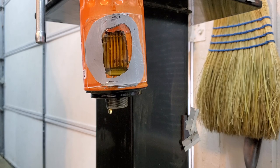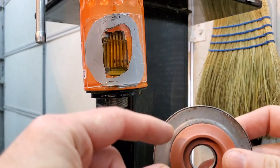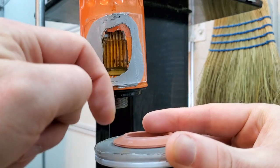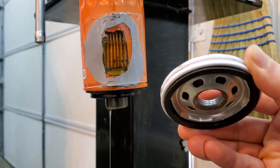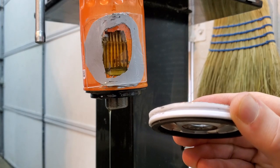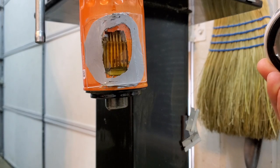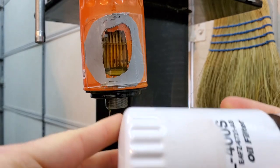You can see it's seeping through the filter media as well — and we're talking not minutes, we're talking seconds. The oil level is dropping because it's not perfect. One function, like I said, is to prevent oil from draining back. The second function: if you have any particles that came through and are stuck, it will prevent them from going back into the system — they'll be trapped on the outside of the filter media. That's two functions of the anti-drain back valve. But does it work as designed? It works to some extent, but it does not prevent 100% of oil from draining back. As you can see now it's just dripping, and we'll have about half the filter drained.